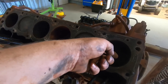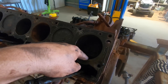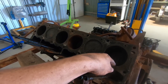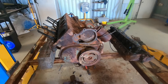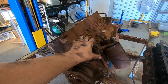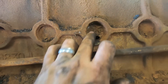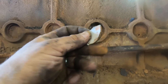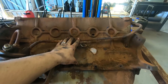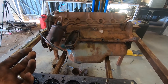Looking into cylinder one, the top ledge is really bad — two to three mil in there. This is going to need to be bored out quite a lot just to fit the right size pistons. If this were just an ordinary slant six we'd say throw it away and find another one, but the fact that it's the matching numbers block to our chassis and gearbox is why we're in a dilemma. We also found, scraping back here, what I think is the reason it was abandoned — the one and two welsh plugs are blown through and someone tried to seal them up with gunk. I reckon this engine overheated, the car was pulled into the creek with the intention of coming back later, and nobody ever did. If it overheated, has the block warped? Has the head warped? What other damage is there?